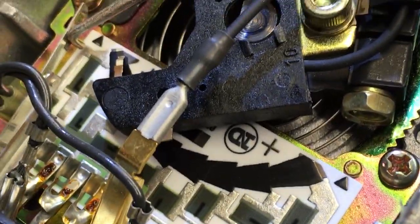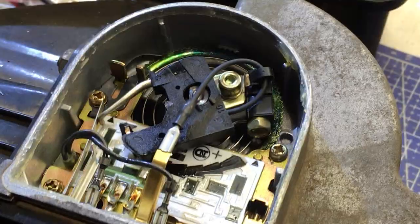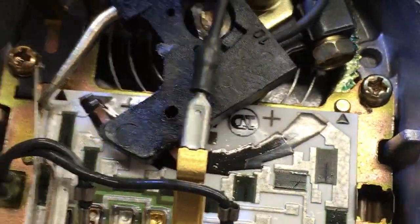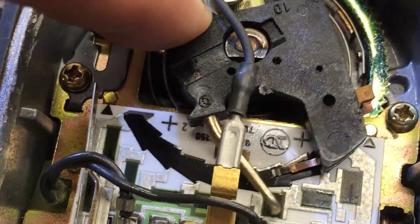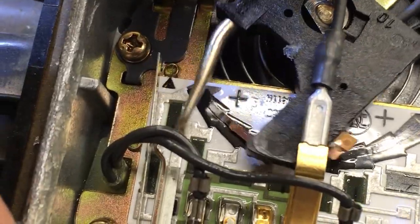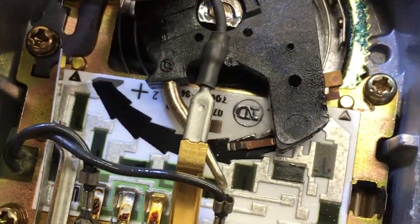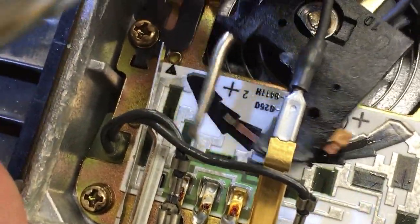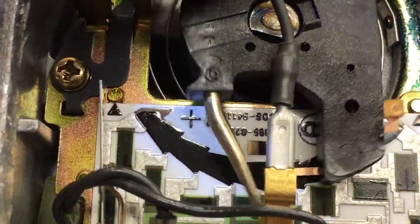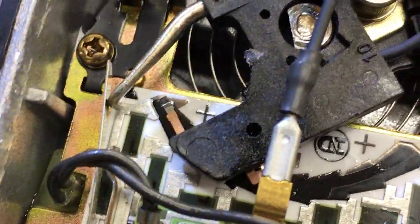Yeah, let me probe around in here. We'll figure something out here and I'll let you know what I figure out. Alright, so here's where I'm at with it. This is the rotational assembly that calculates how much airflow is taking place. There's a stop switch that works correctly. The slide arm, the variable resistance is quite wild. It kind of jumps all over the place as you turn this up and down. I've been cleaning the contact and it's better. It's much, much lower than it was, but it's still not fixed all the way.